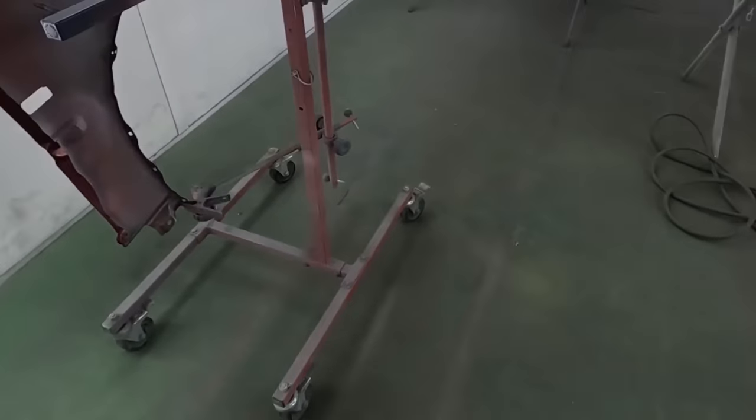Now, this particular job really came out nice, so we will not be leveling the whole entire car because it is pretty smooth as is, but it is because that third coat went on that it smoothed things out and we did not have to get into the blocking of the clear and buffing it. So instead, what we will have to do with this vehicle is just go around to the little pieces of dirt and spot nib them out, sanding them and buffing them, rather than having to sand down a whole vehicle and polish it, which is a huge undertaking.